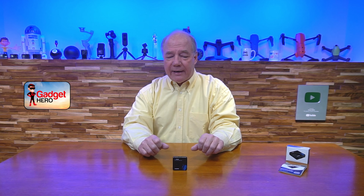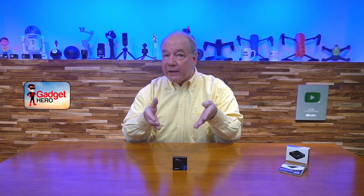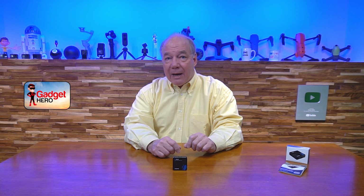Switcher. Now this product is really unique because normally a switcher is a 1x2 or a 2x1, and this product is actually both in a single product. And what I mean by that is, you can connect a single media device up to the input of this and two monitors on the output, and tap the button at the top of the switcher to decide which of those two monitors displays the content from that media device.